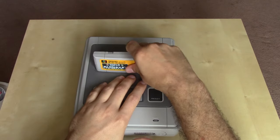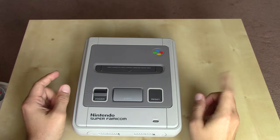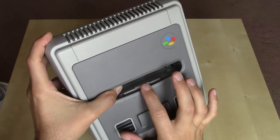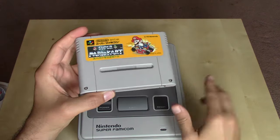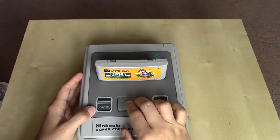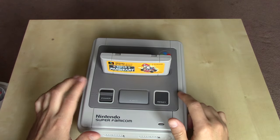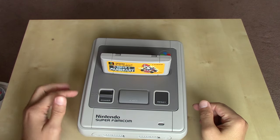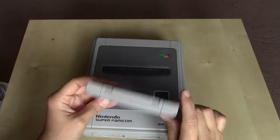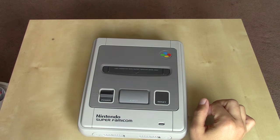There's no real reason you can't just use your hand like with the Sega Genesis or Atari, but Nintendo seemed to like to include an eject mechanism. In the United States, the Super Nintendo Entertainment System had a mechanism where when you turn the power on, a piece of plastic would slide out and lock into a corresponding slot on the cartridge to keep it locked in so you couldn't eject it while the system was on. In Japan there was no problem with this cartridge lock mechanism, whereas in the United States they later decided to eliminate it.